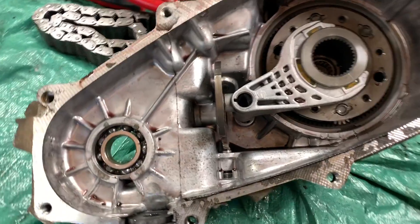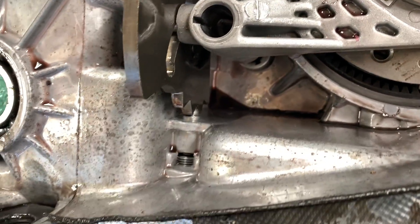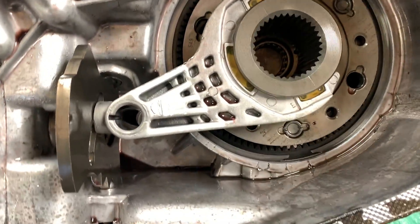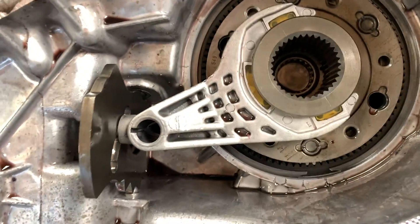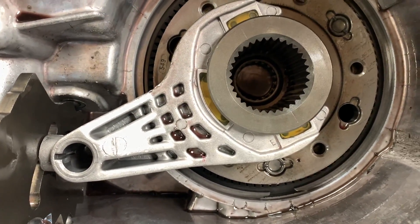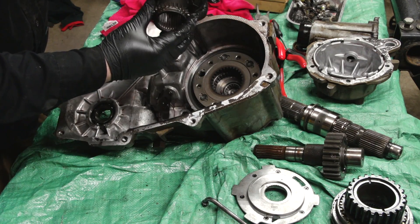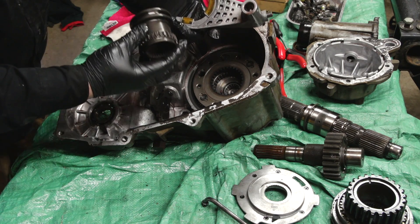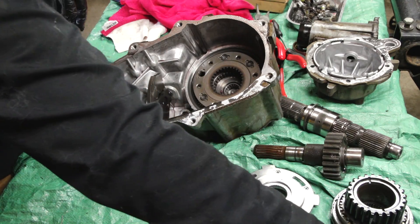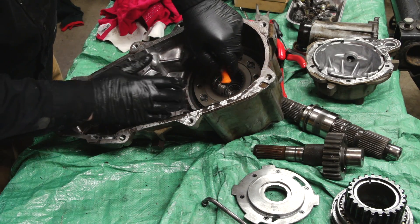All right, inside the transfer case — that's your detent ball for your shifter right down there; it keeps it in gear. This is your planetary — we're going to pull this section out and flip it around. There's also a snap ring down there, but that one's really easy to get out. It should just come right out, just like so. The plastic looks like it's still pretty decent on there. We'll set these aside and probably pull that snap ring out while we're at it.